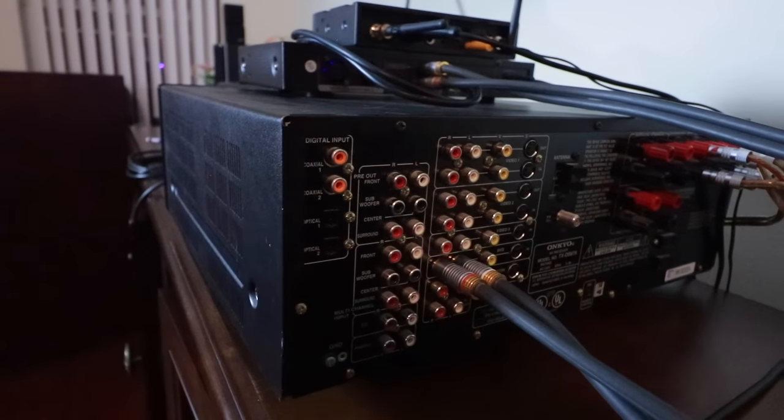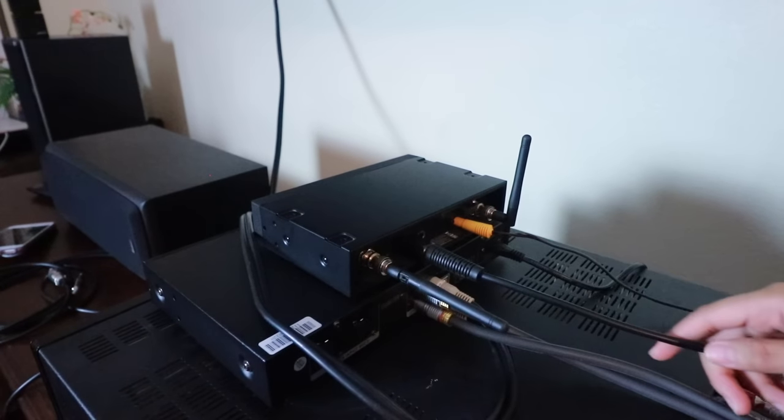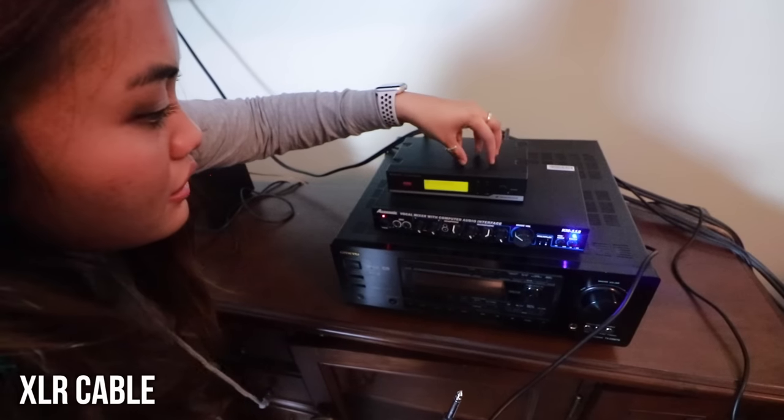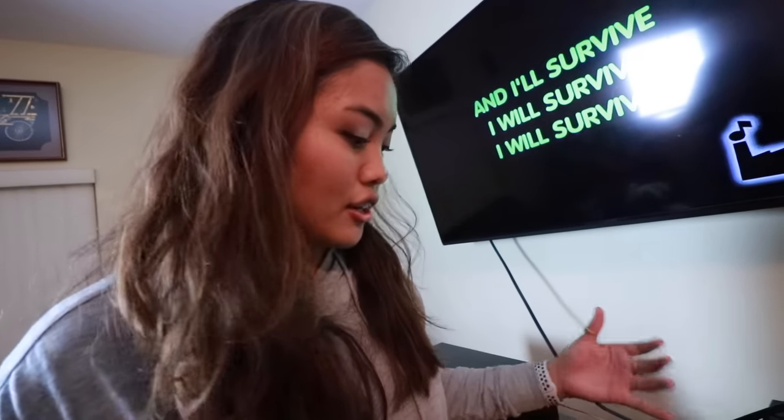So I think everything is connected. If you have a Sennheiser receiver for your wireless mic, you're gonna need an XLR cable, and it's gonna connect from the receiver into the audio interface on mic one or two. Like I said, I'll link everything in the description. And now I'm gonna turn it on.